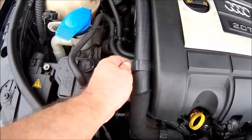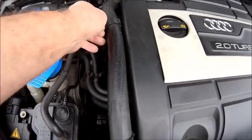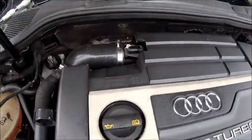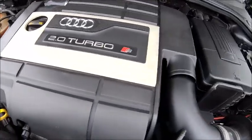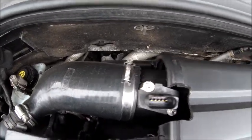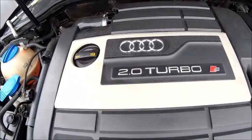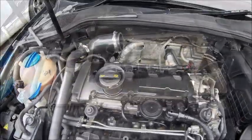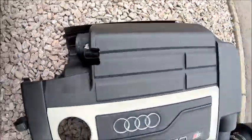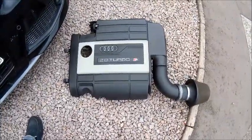First of all I'm going to have to drop the clips off and the piping off the side there. And then basically it should pull off. I'm going to have to disconnect that hose to free the induction pipe because I mounted the induction system within the cover as well — I've got to have two hands to do this so join me in a minute. As you can see the engine cover's taken off. What I did was mount it inside the actual cover itself, so it all comes off as one unit. Not particularly difficult and it makes it look quite tidy — personal choice I guess.